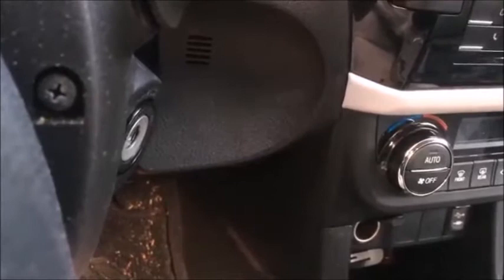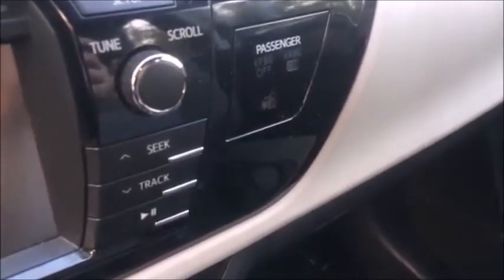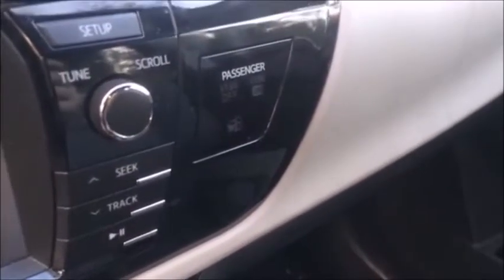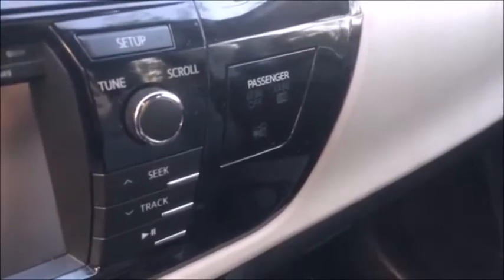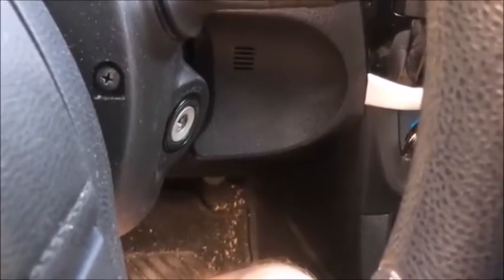I am sitting in a 2016 Toyota Corolla, immobilizer-equipped with the H key. There's our immobilizer light right there. I want to go over the difference between the master and the valet transponder inside the key. If you're doing an add key, you must have a master transponder. There have been many calls with a no-key situation — people using a valet chip or trying to add a key when the customer only has a valet. You must have a master to start with.